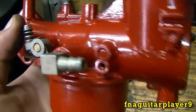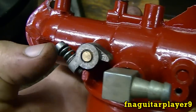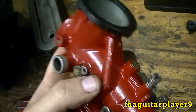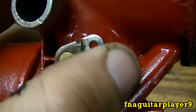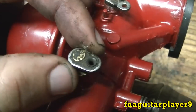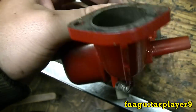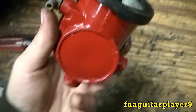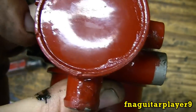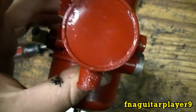This one off the engine shows everything better. This is your throttle; this sets your idle speed — screw it in to turn it faster and back it out to slow it down. This is your idle mixture adjustment screw, and your main fuel adjustment screw is on the back side. This is your choke right here, and there's the throttle connection point. You can actually see the throttle plate on this one. If you ever need to work on the throttle or choke plate, you have to pop this Welch plug in the back — it's been staked in two places. You put the new one in by staking it about four or five places and put a little sealant or JB Weld on it.